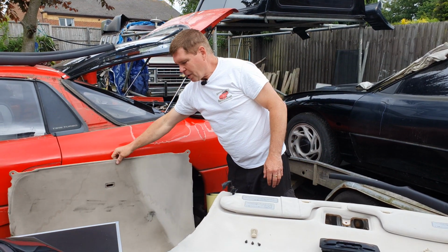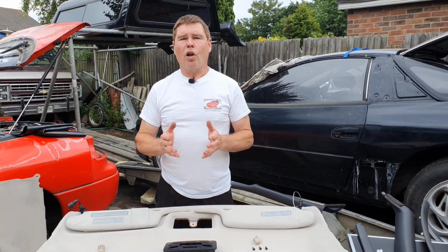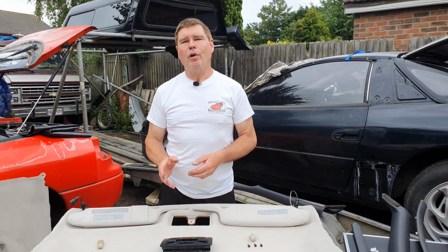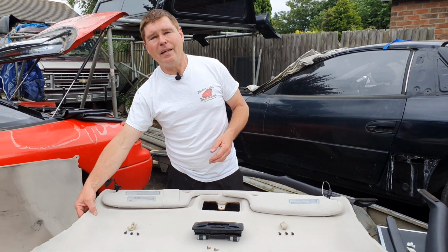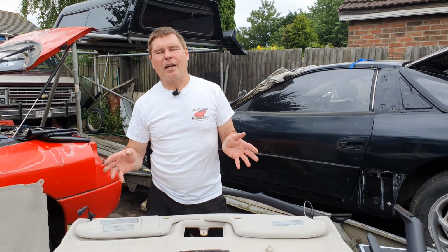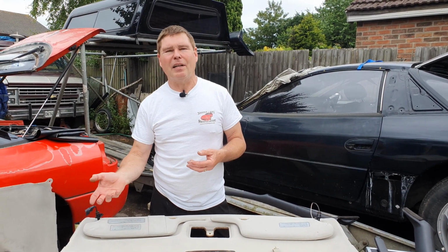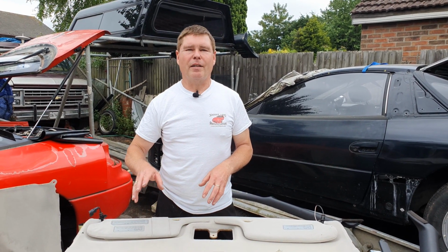As far as cleaning these goes, you've got to be very careful what you use to clean them. Lots of water is a really big mistake, because the water soaks through the liner and goes to the wood pulp backing. The wood pulp backing gives off, I call it a dye for lack of words. There is something that leaches out of it, and it will cause you horrible staining of the liner. So whatever you do, do not get it too wet.